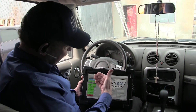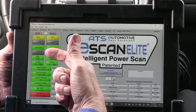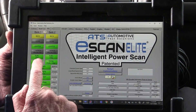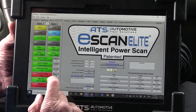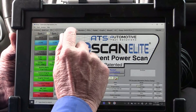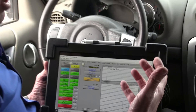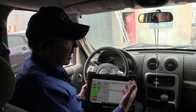Now that we've got it running, I've got some scan data up. We can see that we have fuel control. Everything looks okay. The bank-to-bank trims, total trims are good. Long-term is good. My vacuum is good. Charging system is coming up and down as high, but it's cold. And I have no codes. Basically I have no codes, but I have a stalling issue. So the codes and the scan tool really aren't going to help me right now and I really need to just get this diagnosed.